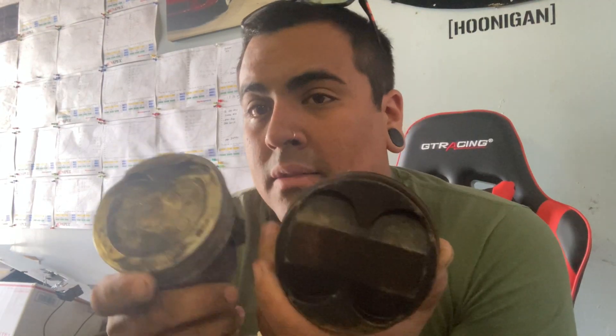If you don't know anything about compression ratios, let's talk about this too — it's a big part of the 1.5J thing as well. High compression means you need less boost to make a bigger horsepower number. On the GTE piston, running a 264 cam, at 14–16 PSI we're already hitting 500–550 horses. But this GE piston at 12 PSI with cams will be at about 500 horsepower as well. The torque number on the high compression piston will be consistent with the horsepower, whereas on the other one you'll probably see about a 100 lb-ft decrease in torque versus horsepower.